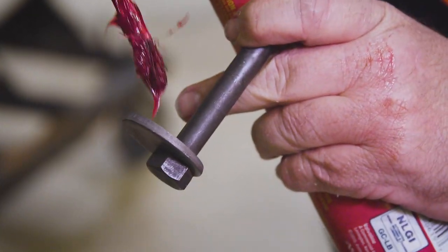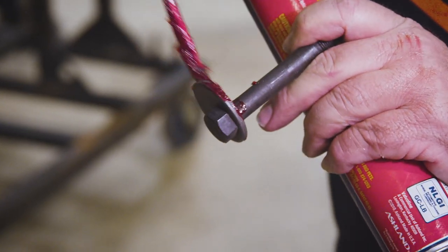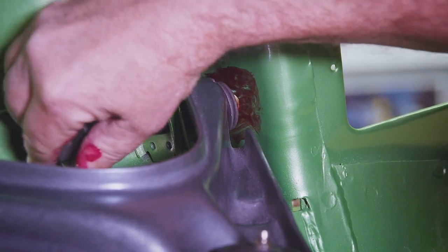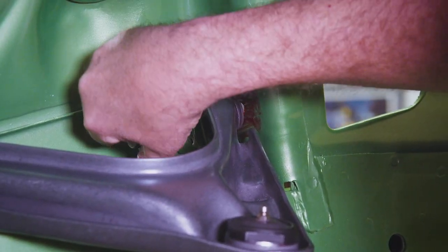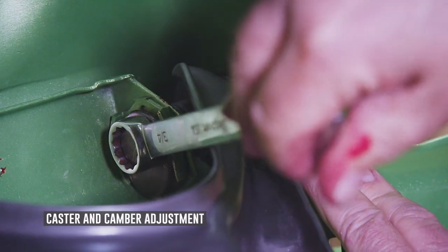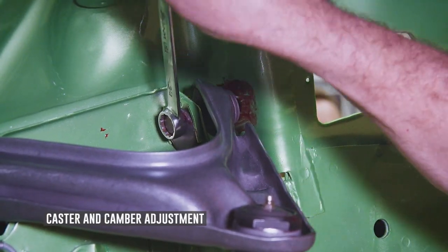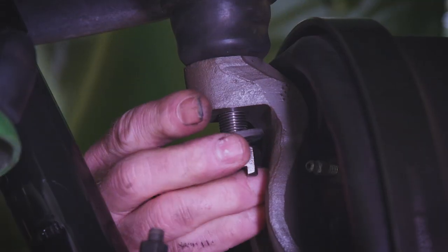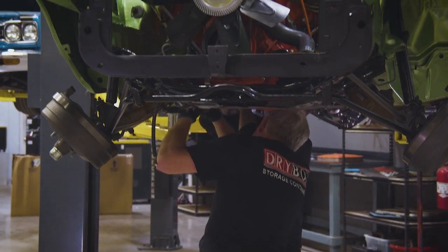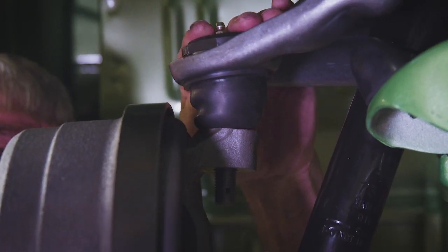This is exactly how the factory did it — maybe not in the same sequence, but basically the same way. Back then they lifted the engine up into the car and the car may have moved down on top of it. In our case, the car is stationary on the BendPak lift. We raise the K-member with the transmission and crossmember up into place, line it up in the holes with the frame rails, and install the K-member bolts. Once the bolts are in the front, you go to the transmission crossmember, put the bolts in, tighten everything down, put the natural weight of everything on the drivetrain, and begin building out all the peripheral parts. Upper control arms get put into place with the adjustable cams to set caster and camber alignment. Once you have all those pieces in, you can install the driveshaft and you have a front-to-back drivetrain, at least down low.